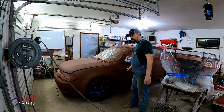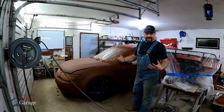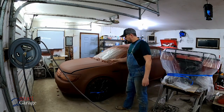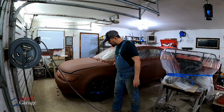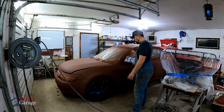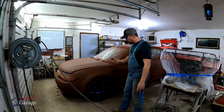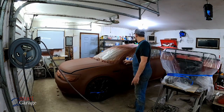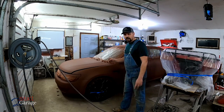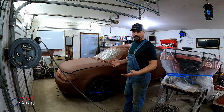Primer laid down. This primer is really forgiving. I'll have everything that I used, at least I'll try to get everything in the description in the video. When I'm laying down the black, this first coat is going to be a little bit darker than you might think, but I'm going to try to cover this thing with two coats. So I'm going to go a light to medium coat on the first coat on this primer. Then on the second coat, I'm going to do a medium to thick, and it's probably going to be more along the lines of thick because I got to try to get it to lay down nice and smooth.